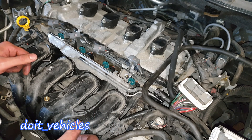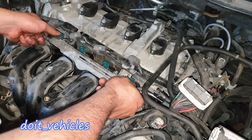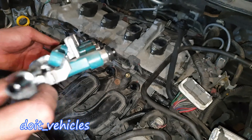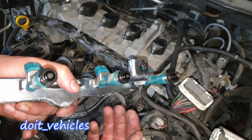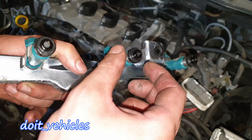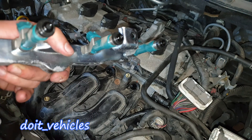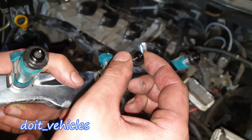You're going to need a 12mm socket to release the fuel rail. In general, on an engine there are many points where you can find a vacuum leak that will make your fuel system go lean. One of those points is by the injectors — there is a small gasket here. You can easily remove the fuel rail by hand on this car, which actually indicates a weakness: if these gaskets fail or crack, you've got a massive air leak.